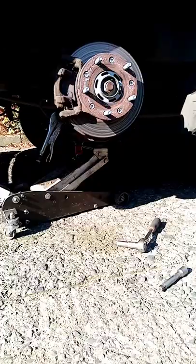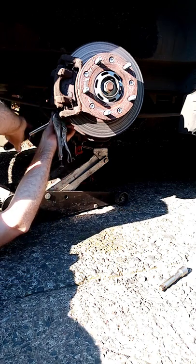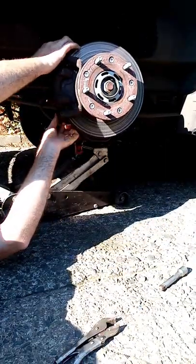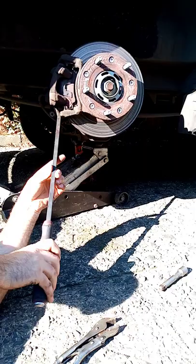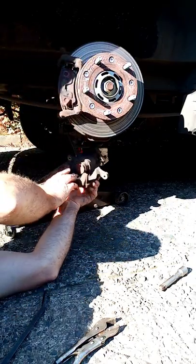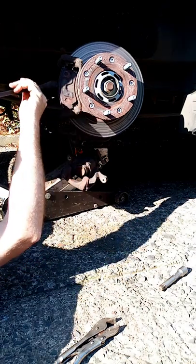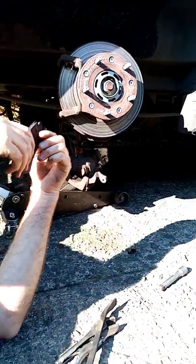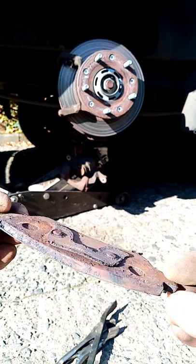Right, let's get it pulled apart. I'm just going to get this carrier off — I've got one bolt left in, I've done the top one already. The sliders are free anyway so they're not seized. I'm just going to get the pry bar out, just ease that back. And put the pry bar in there again, just ease the outer pad out — what's left of it. And look at that, that's what's left of that outer pad. Wrecked.